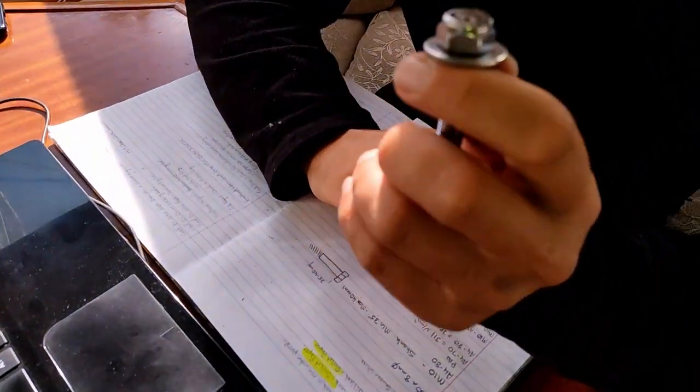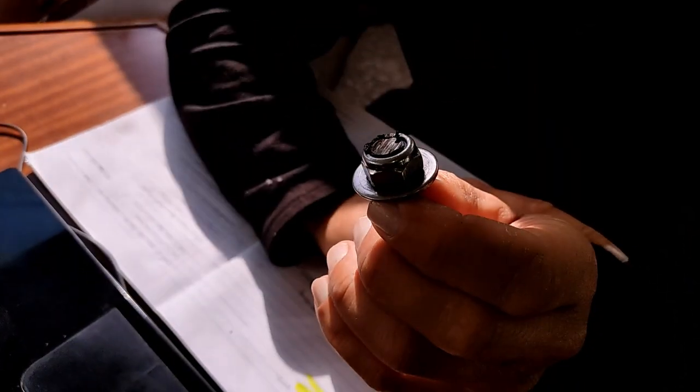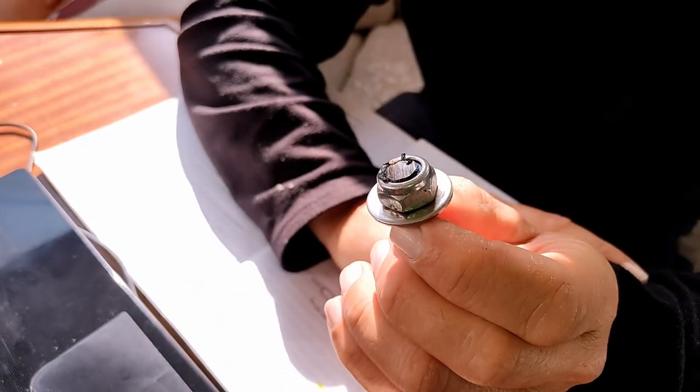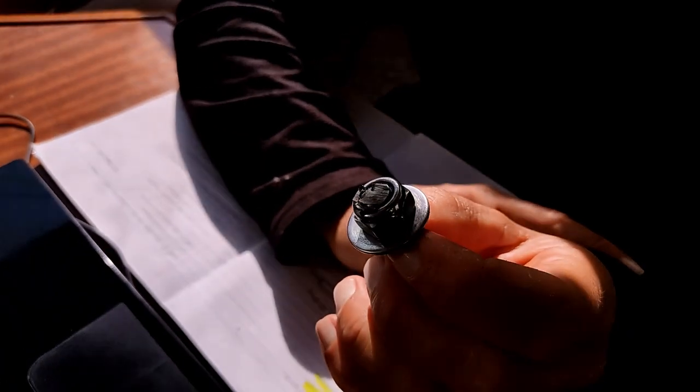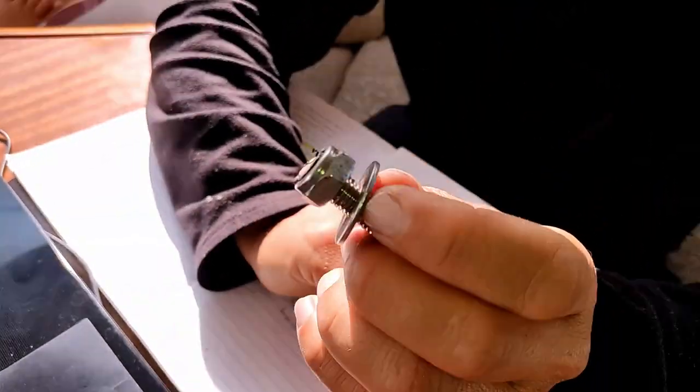The other pain is that when you get shanked ones, to get the shank the right length the thread's always going to be too long, so you've got to cut them all. It's not going to be a five-minute job changing these bolts because I'm going to have to cut every single one of them to the right length. And I'm not going to do it with a four-inch grinder and melt the nylock out of the nuts like they did at the factory — that's a no-no. If you're cutting bolts, you don't use a four-inch angle grinder with the nut on the other side with the nylock because the bolt heats up, melts the nylock, and the nylock's completely redundant. You do it off the job, file or sand a radius onto the thread so the thread works properly, then put the nylock on.